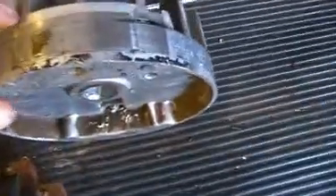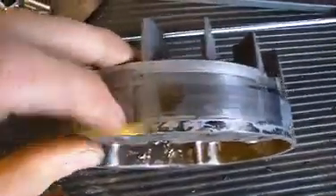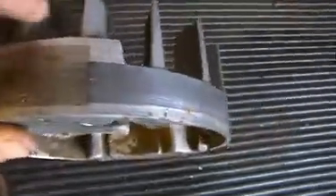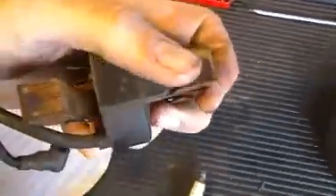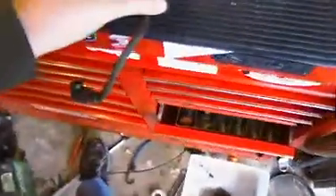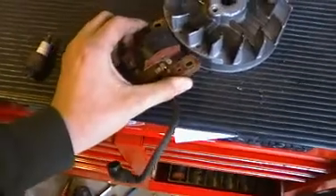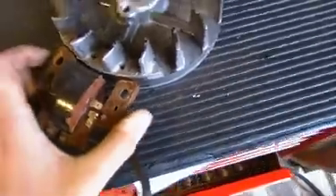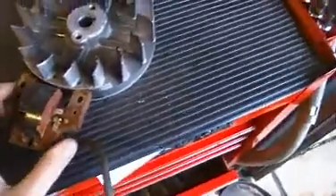You'll want to sand the magnet points on your magneto, which are right here. You'll see they're slightly gapped right here and right here — that's how you can tell it's a magnet. There's one on this side and one on the other side, gapped right there and right there. You'll want to sand those, and you can see that this coil is dirty. Sand right here and right here — these are the places that are close to the magneto when being used. If those are rusted, that will not deliver a very good spark.